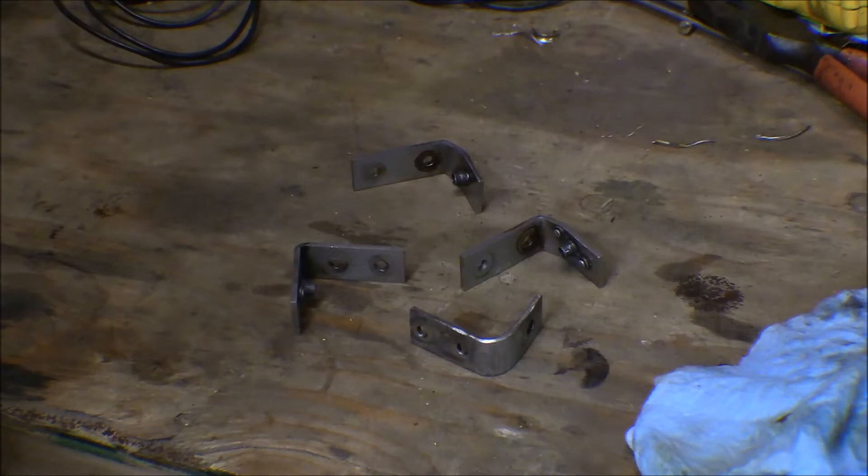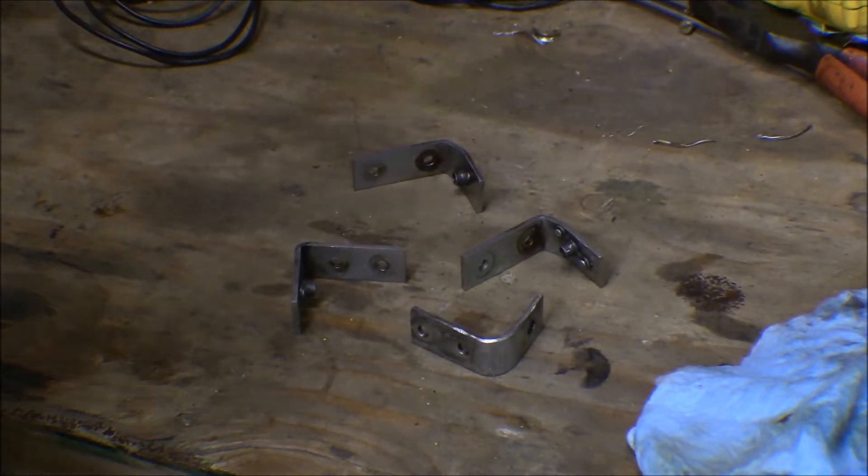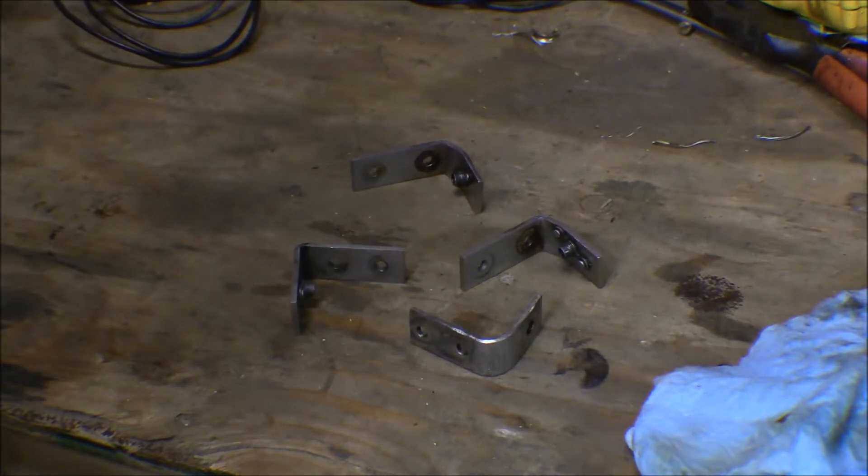I screwed up on getting the tail installed right away. I broke that tail wheel steering fork because I was drilling it out to put the bolts in it, so I kind of messed that up. The tail is all together except for that, but I'm going to wait to put the rudder on until after I get that fork fitted up. It's easier to do with it on the bench than it is hanging from the airplane. So everything back that direction is pretty much done until I get that ready, so I guess it's time to move forward to the engine.